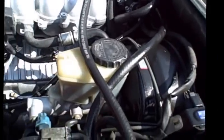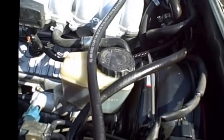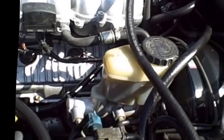So what I had to do is, there's already that little cutout in there for the pilot bearing. What I had to do is get a pilot bearing for either a 3.4 or a 3.0, and they both turn out to be the exact same part number. Just go ahead and slap that in there using the correct size socket to slam it on in, and all your other 3.0 clutch components are going to be okay in it.